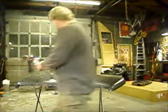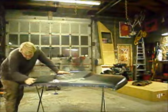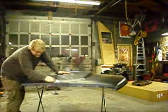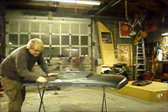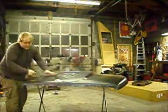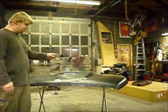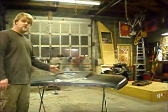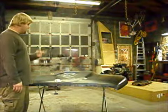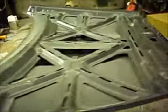I like this — this is working. You just gotta go over the whole thing. I think you guys get the picture: you want the whole thing to be dull, you want no shiny parts at all, that way the paint will stick to it. I'm going to scuff the rest of this hood, flip it over, scuff the underside, and then I'll turn the camera back on.